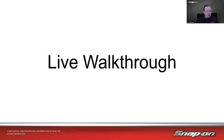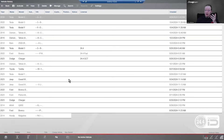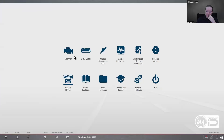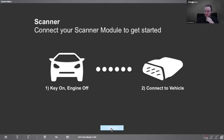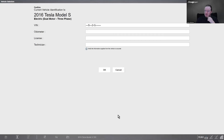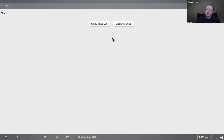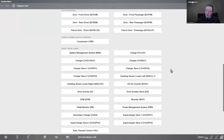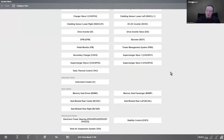Let's go live on the tool and see what we can see. I'll go through each of the vehicles we looked at, starting with the 2016 Model S. On a 2016 Model S, it has a diagnostic connector underneath the dash. We have the option to display active ECUs or display all ECUs — I'll display all that could possibly be on there. You can see code scan, clear codes read by code scan, electronic parking brake, occupant classification system, and so on through all the different modules.